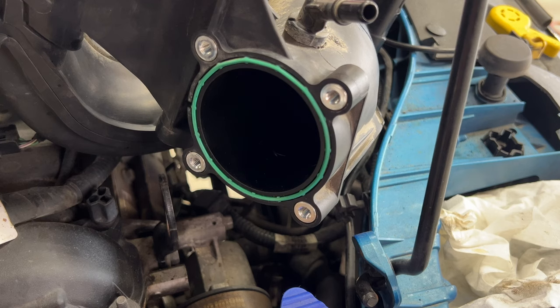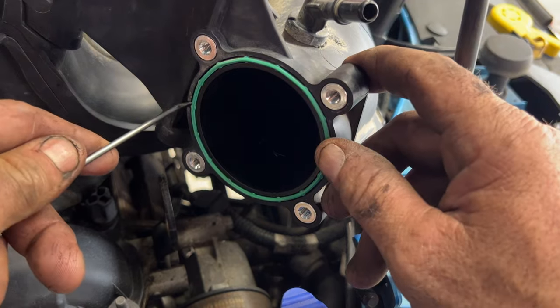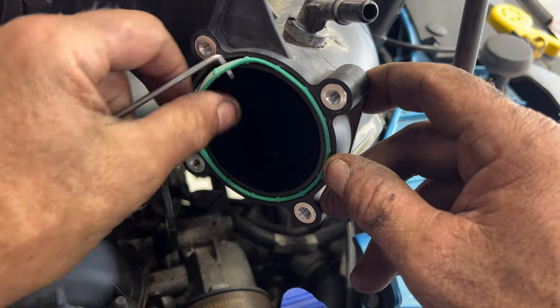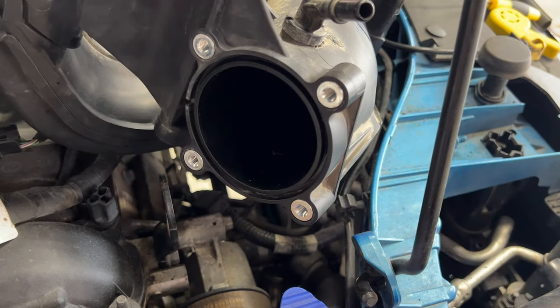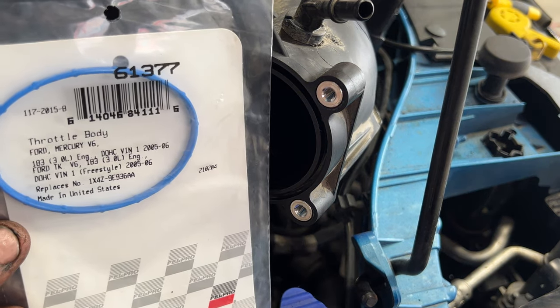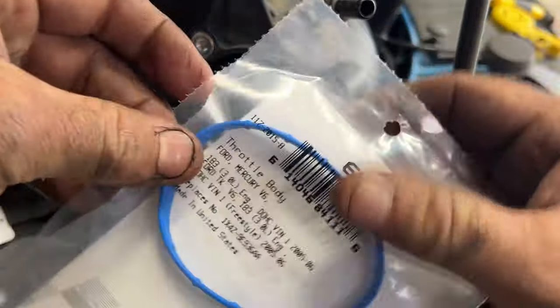Then you can come over to the side of the intake there, and I am putting a new throttle body gasket on here. Same thing, you've got a little slot right here. Go ahead and get under it with a pick. Pull that guy out of there. And for the throttle body gasket, I'll be using this Fel-Pro one as well, 61377. Put a link in the description for it as well.